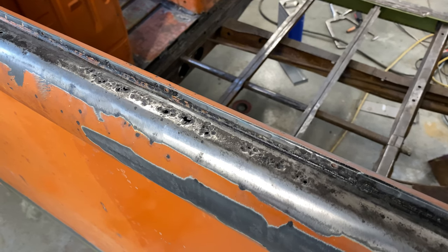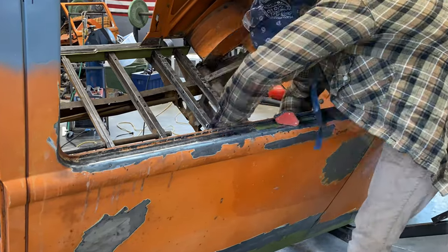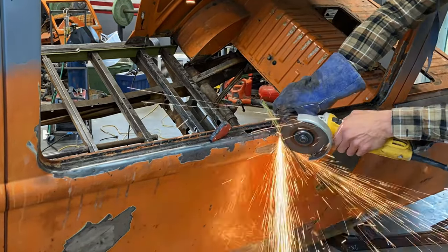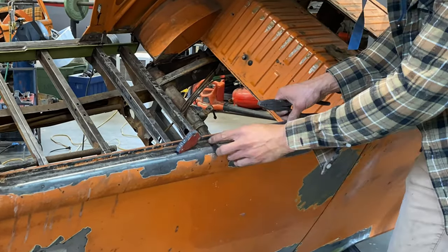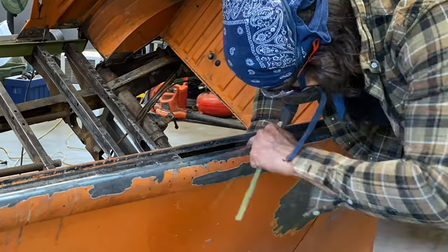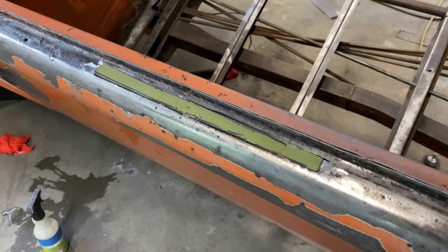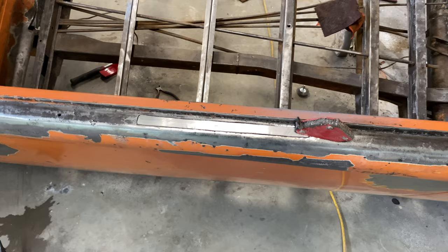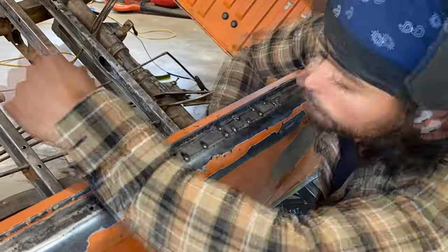Now that that whole ordeal was over and done with, I could move on to what I originally intended to do in this episode — repair the rust on the windowsill. If you have any questions about the techniques I use, feel free to leave them in the comments. I'll give you a simple explanation: I cut out the rust — anything that's pitted or has a hole, I do my best to cut it all out, because rust never sleeps and it will come back. I'll cut out my repair section a little bit oversized, then using a flap disc, trim down the sides until it's a perfect fit. I'm using the funky green panel cutoffs as it's really good metal and I had it laying around.